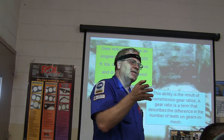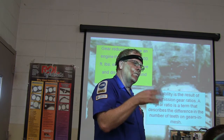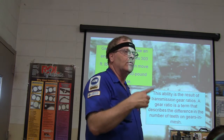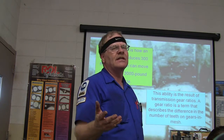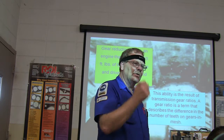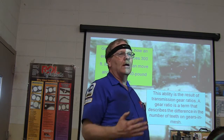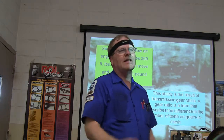What kind of gear ratio is first gear usually? About 4 to 1 — four turns of the engine for one turn of the driveshaft. How many of you have ever ridden a 10-speed bicycle? Whenever you're in low gear, your feet are spinning fast and you're going really slow, but you can pull a long hill without a whole lot of energy.